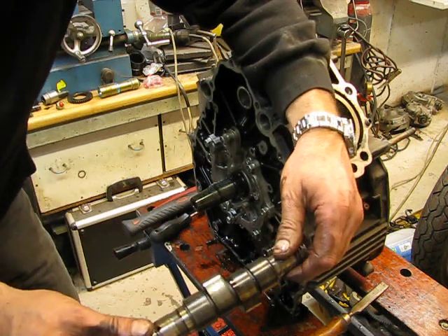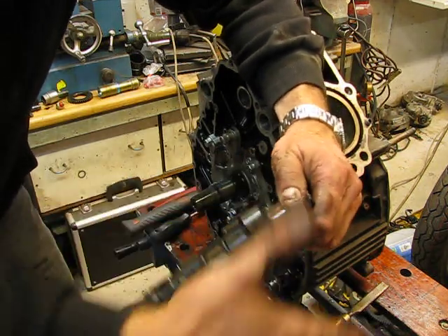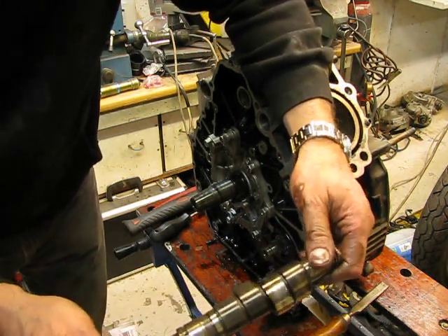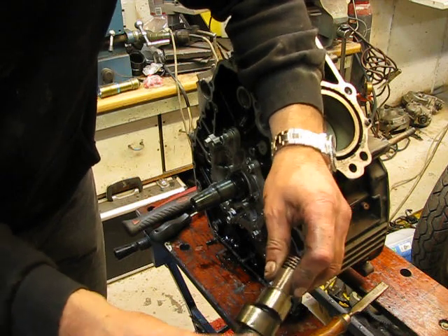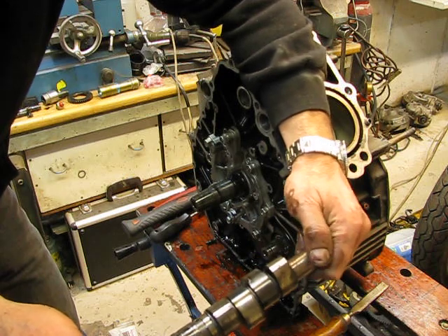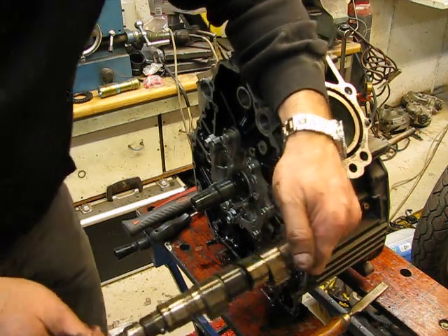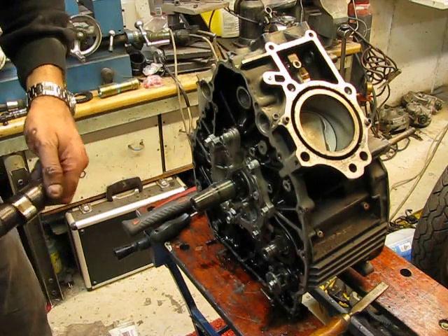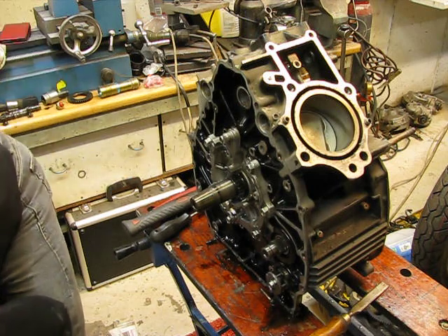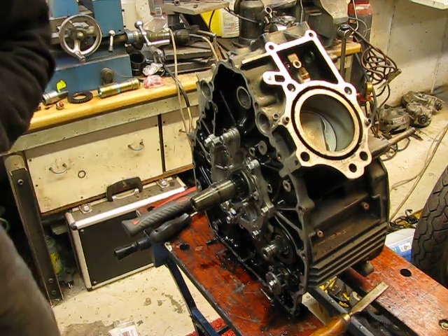They were gripped with a special plier. There is not what I want to see. This knock is also burned or ground away. Strange — it seems the camshaft was very, very hot, but I don't believe so. The oil has burned out, I think. I can see more problems. I need those camshafts because I want to improve the power of a 500 engine.